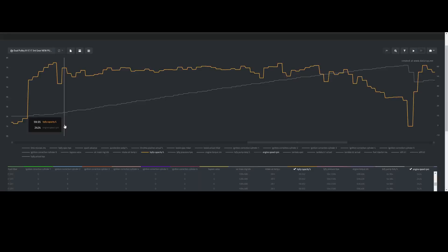Here's a log of that run utilizing the exact same tank of gas — E17 blend, dual pulley 91 octane file. I see 59.55% duty cycle at 2400 RPM, and as you can see it drops and goes up a bit, but only ever so slightly. There are no crazy increases, no crashing to zero. It is maintaining the fuel pressure and meeting the demand it sees. The highest we see is 64% duty cycle at 5700 RPM. This is what a healthy high pressure fuel pump should look like, and I now know my fuel pressure demands are being met with ease.